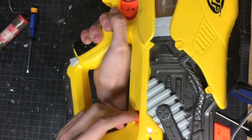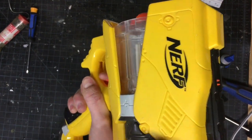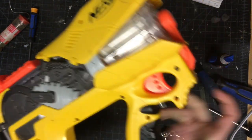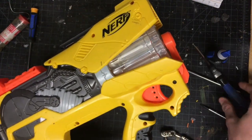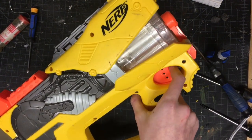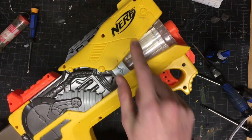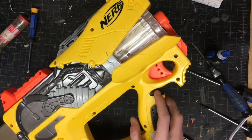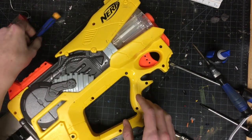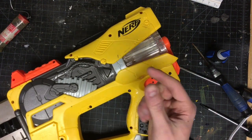Let's see if this works now — yes, it does work. Fantastic. So if you think the light in your Firefly is burned out, I would definitely check the little contact area behind the trigger. That is far more likely to be broken than the light is burned out, because those leads are very fragile — so definitely see if they're both there. If they're not, you could probably make a lead; they're very simple, just a little piece of metal.